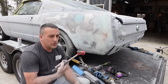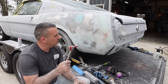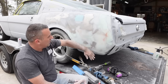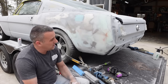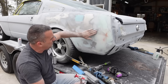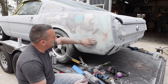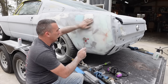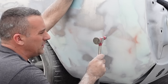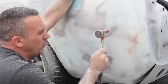The best thing to do is use one of these pointed hammers because they're more precise and they actually do less damage than you'd think. They put little indentations in the metal but also help filler bond to it. Here's a perfect example — you've got a high spot down to bare metal, which means the block is laying on bare metal and can't do anything else, and then there's a low spot in the middle. You want to go around the dent or high spot and start working your way in.